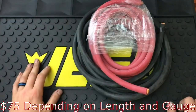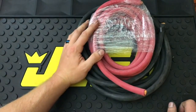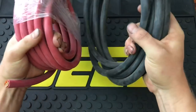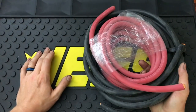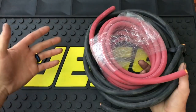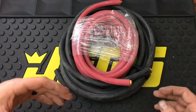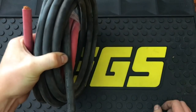I'll link all these products down in the description and try to throw in the price. This is 15 feet of negative and 15 feet of positive. I still have to determine if I'm going to mount my battery in the box I built for my rear seat delete or run it all the way to the rear. In the description where I have this linked, it shows you that 15 feet of zero gauge is good for 285 to 315 amps. Make sure you get the correct size — you don't want to overheat or start a fire in your vehicle.